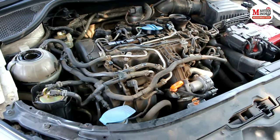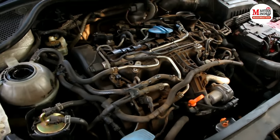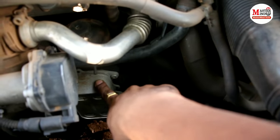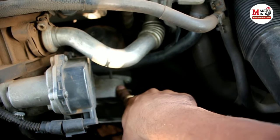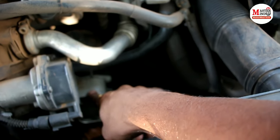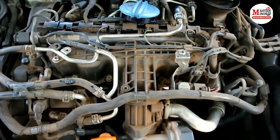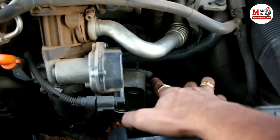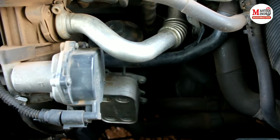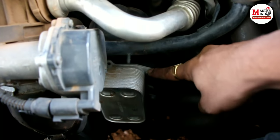The problem is mostly the oil cooler. The oil cooler is responsible for maintaining the temperature and circulation of the oil. The gasket ring on the oil cooler body has gone bad. The other possible problem is the head gasket — if the head gasket has been cut, that is also a cause. We will first remove and inspect the oil cooler, as it is the most likely culprit.